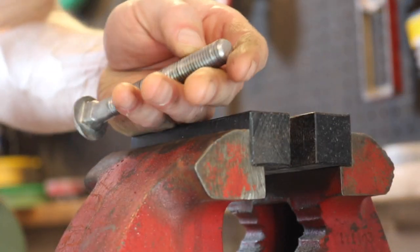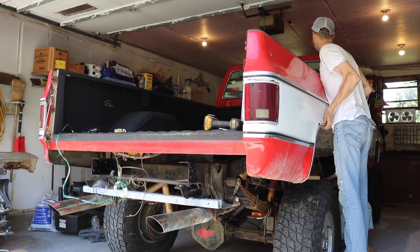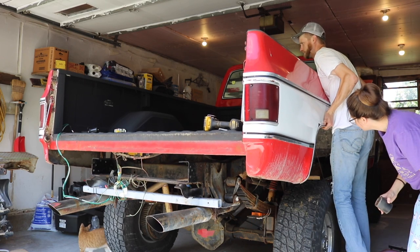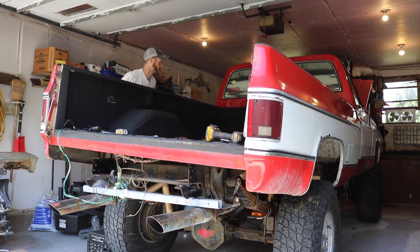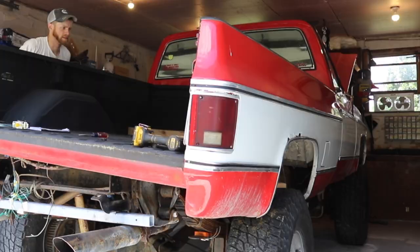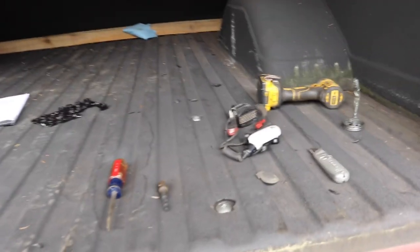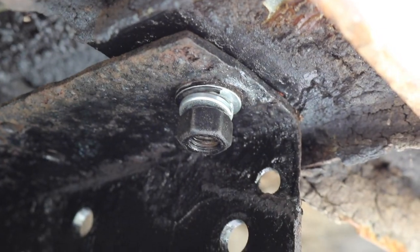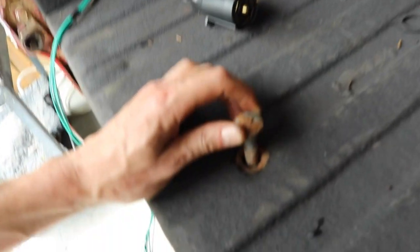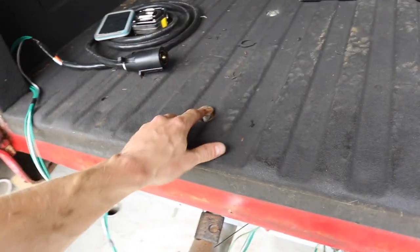It's not coated there because you've got raw metal, so it's helpful to either paint it or put anti-seize on there for corrosion resistance. Now that I got all the bolts cut, I put anti-seize on all of them and dropped them into place with the body lift blocks down. A couple of the bolts I need to replace with normal bolts because the carriage bolt is stripped on the bed side, so I'll leave those in to keep alignment. Body lifts off — bed dropped, tightened, done.